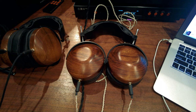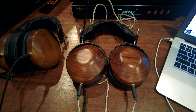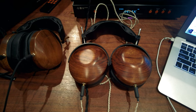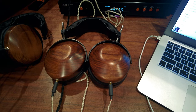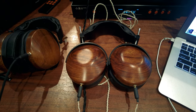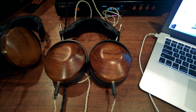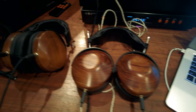I've found that low impedance drivers do better with the Harman tuning than high impedance drivers do. Did a lot of tests back and forth with that — similar to Harman but with a little bit of a dark tilt in the treble, because that's my preference to not have the treble in the 3 to 6K area be quite as hot there.